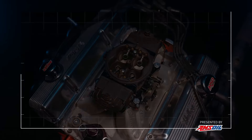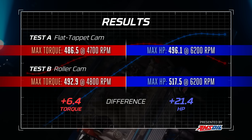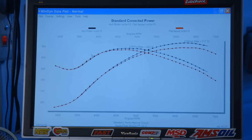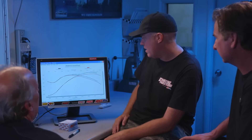That's way better. Let's look at the overlay versus the flat tappet. Our official run with the roller cam: 492.9 pound-feet of torque and 517.5 horsepower. Not as much better down below 4,300 as I thought it might be. But up here when you start picking up engine speed above 4,500 — the roller is way better. It really needs the additional airflow.